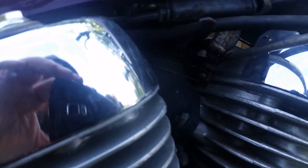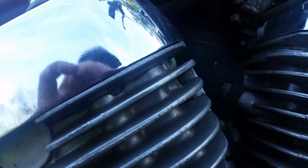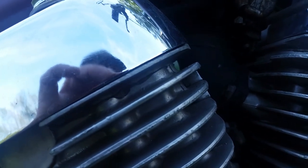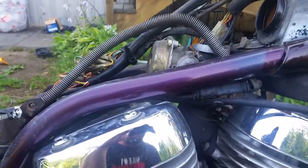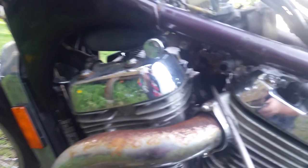I'm going to pull the drain screw out here. Look at that — no fuel coming out of that carb. None. Clearly there's an issue here. It's been running on that carb with a stuck float. It could be a number of things going on with it, so we're going to find out what the hell is going on with both of these.